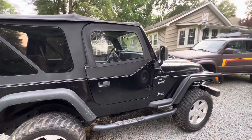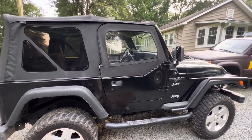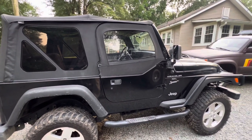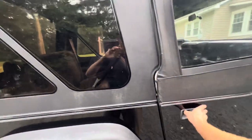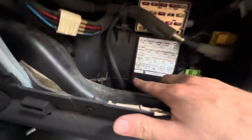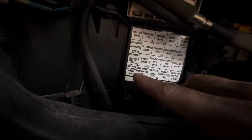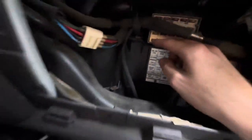I'm going to do a video on how to bypass the clutch safety switch on these TJs — for sure '99, and I'm sure all the other manuals. You can go into the glove compartment and throw a 20-amp fuse in the auto trans C owners manual slot, and then you can crank it without having to use the clutch.